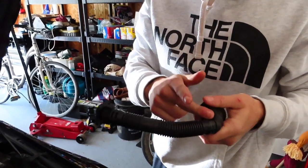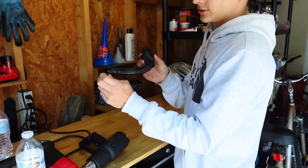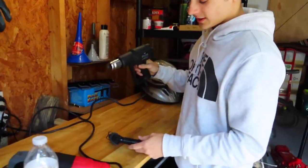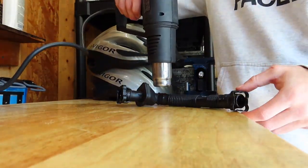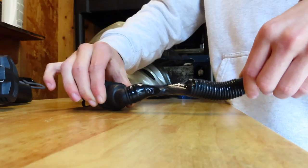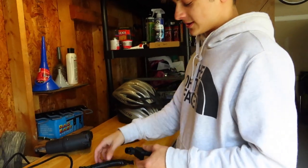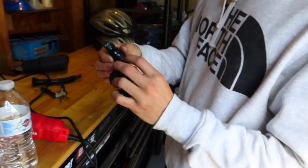We got this out now. All you've got to do is take this hose off — you've gotta use a heat gun to heat it up and pull it off. You actually don't need this side of it, so honestly if you wanted to you could just destroy these clips. But you definitely need these clips because the only piece you need from this is the flapper — there's a flapper inside of here. I used a heat gun — you can use a hair dryer if you don't have one — just heat up around here. I heated it up and it kind of destroyed, then I used snip cutters and cut my way down. Now it's off.